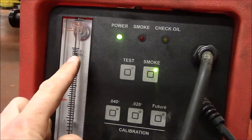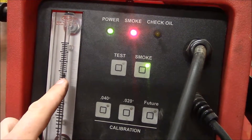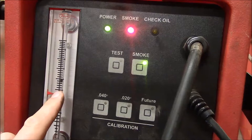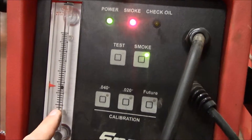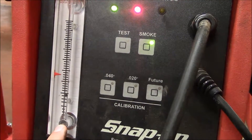We're seeing the ball all the way at the top. As the pressure of the tank begins to equalize, the flow is going to decrease, and we should see this ball rest all the way down at the bottom if we have sealed all of our leaks.